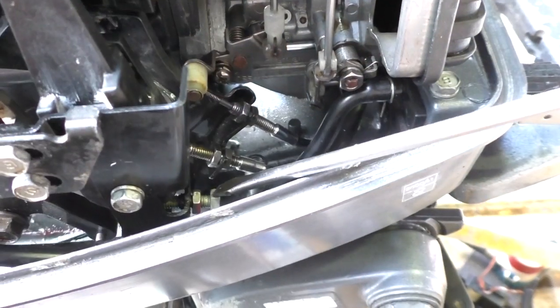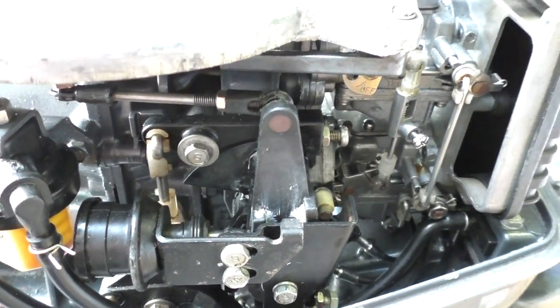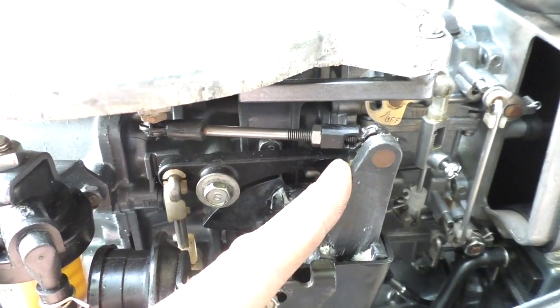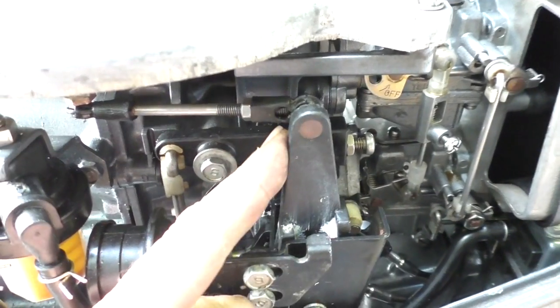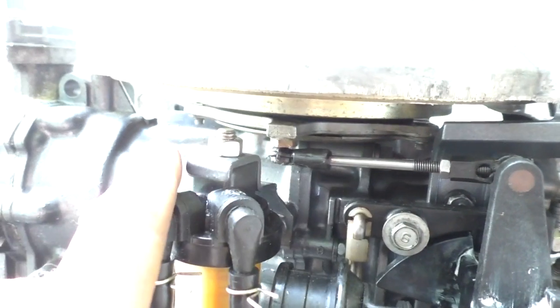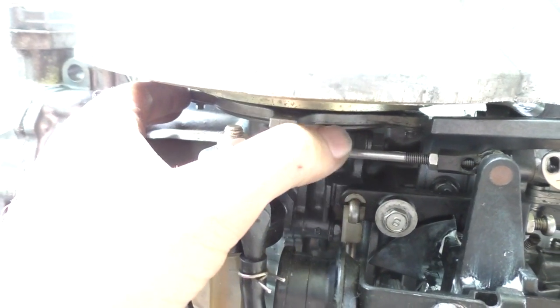I'll show you how we adjust it, then I'll set the camera back on the stand and slowly adjust it until it gets to seven degrees after. Down here there's a little stopper screw, and what that does is it pushes against the bottom of this lever. The more we push down the bottom of the lever, the more the top of the lever pushes to the right, because that bolt is pushing it to the left, and vice versa. What we need to do now is wind that bolt outwards so that the lever is able to move to the left, and have the stator plate underneath the flywheel rotate clockwise — the same direction as the flywheel's turning — and that will retard the timing.